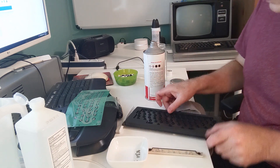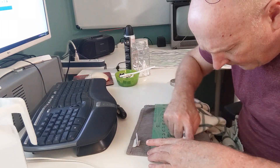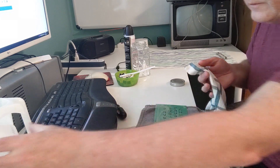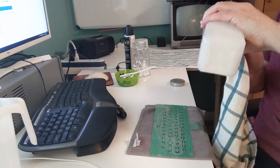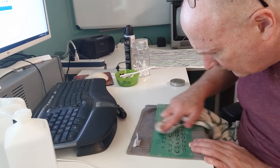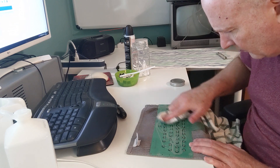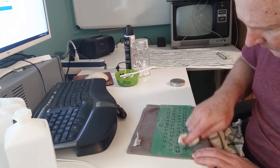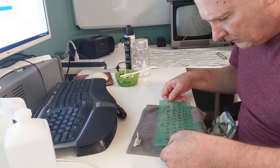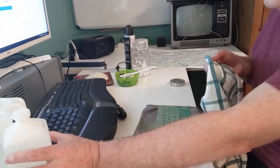Halfway through, I discovered it wasn't as hard to take the space bar out as I thought — sometimes I leave those because they can be tricky to get back in, but in this case it wasn't a problem. For cleaning the plastic mylar strip, I'm using a soft clean towel — you can see dirt coming off. I'm using alcohol very lightly, really trying not to damage it. It appeared in pretty good shape and not at all brittle, so I was fairly lucky. Be careful — you could really destroy your whole Coco with this. Try the front first before going into this.